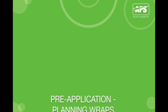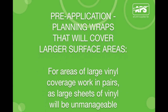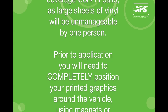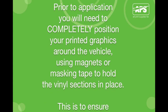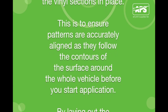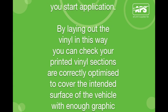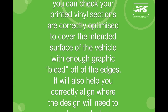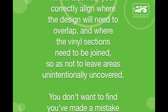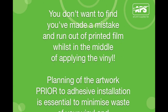For the application, planning wraps that will cover larger surface areas: for areas of large vinyl coverage work in pairs, as handling large sheets of vinyl will be unmanageable by one person. Prior to application, you will need to completely position your printed graphics around the vehicle using magnets or masking tape to hold the vinyl sections in place. This is to ensure patterns are accurately aligned as they follow the contours of the surface around the whole vehicle before you start application. By laying out the vinyl in this way you can check your printed vinyl sections are correctly optimised to cover the intended surface with enough graphic bleed off the edges, and correctly align where the design will need to overlap and where vinyl sections need to be joined.